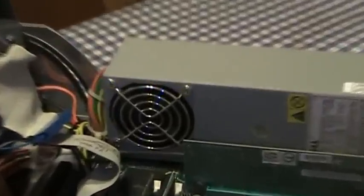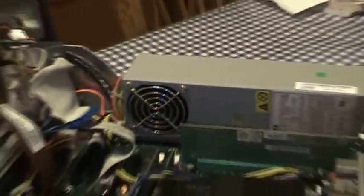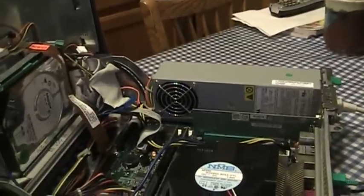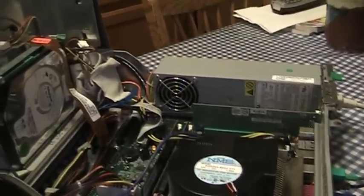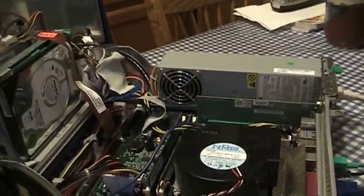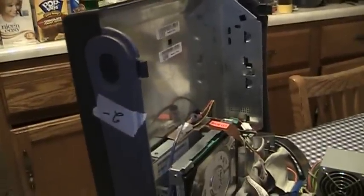This power supply fan, it's spinning, but it doesn't move any appreciable amount of air to speak of. There's barely a breeze here, and there's nothing coming out of the back of the power supply. So that probably accounts for some of the longevity that I've noticed from the power supplies in these particular systems. Can you tell I think that these were a horrible design decision? I like Dell's products, don't get me wrong. But I don't think these were their shining hour. None of these small form factor systems with a Pentium 4 processor. And they're just bad news. My dad gave $2 for this at the moving sale, and I'm here to tell you that I think that was probably about $10 too much.